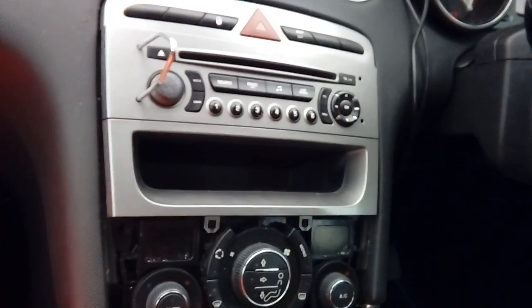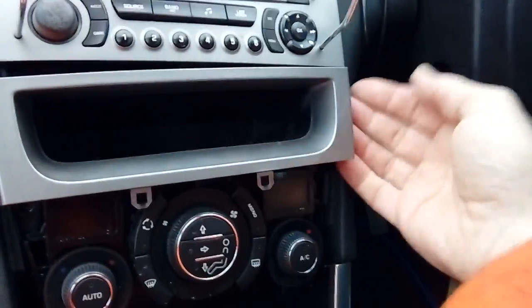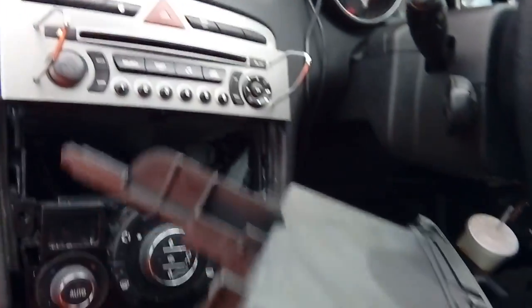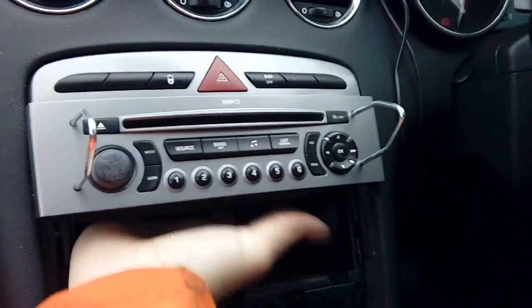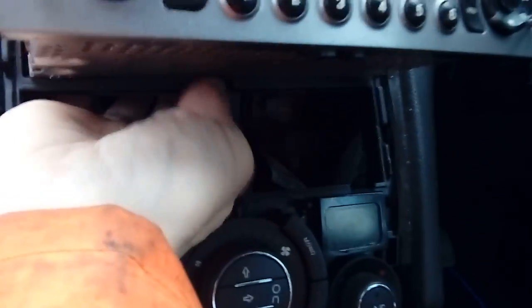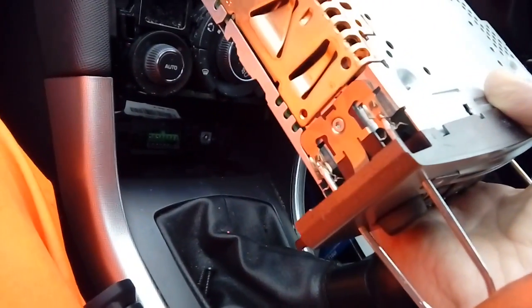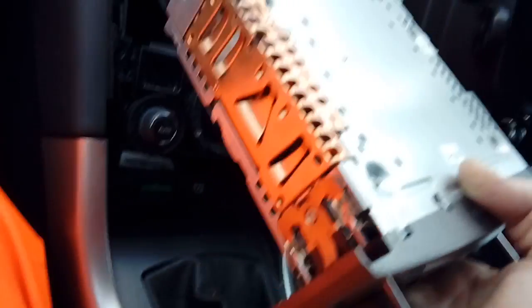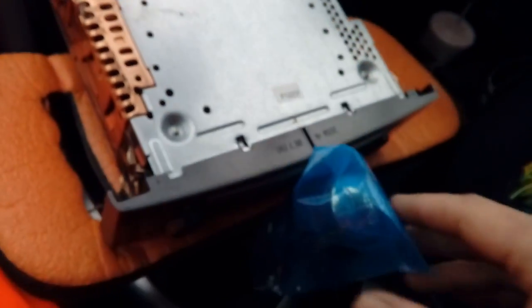You should now be able to take your keys out and remove the radio — both hands needed. These can stick; this one had stuck on the right hand edge and took a little bit of leverage with the plastic tool to get it to pop. There you go — take that out intact and save it in case you ever sell the car. The radio at the top just comes out now. If you're worried about damaging the painted surface, put a piece of cardboard or foam pad underneath it to rest the radio on.